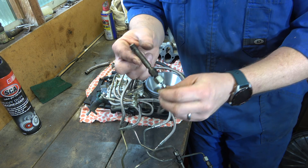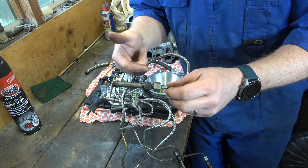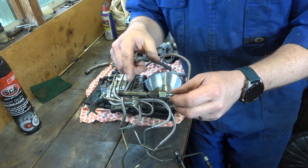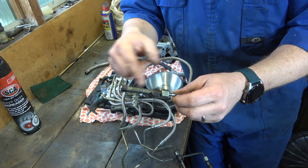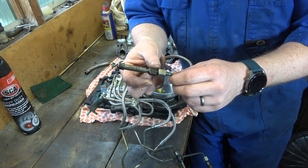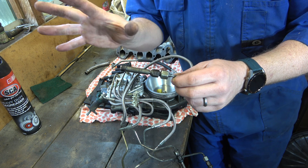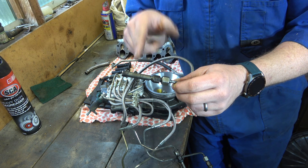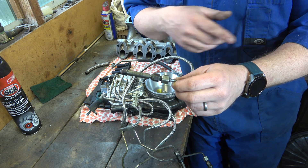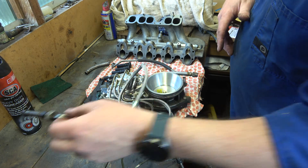You can't really clean them with an ultrasonic cleaner because there's a built-in filter and you need to reverse flush them, which is a bit of a pain to do. There's a channel on YouTube called Mercedes Source that's got a setup for doing that — I'll find a video and put a link below. In my experience if you get poor injector spray, just replace the injectors. They used to be really cheap but these days they're about 50 bucks a piece, so if you've got five cylinders that's 250 dollars — it starts to get expensive.